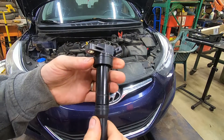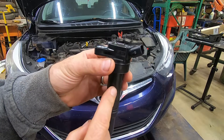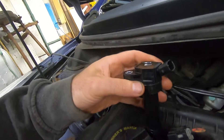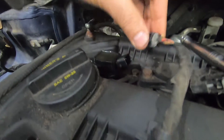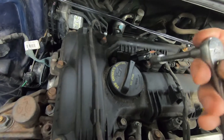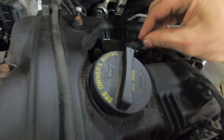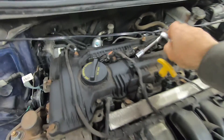Here's our brand new coil direct from Hyundai — this is a factory original. To my surprise, it was actually cheaper than the three aftermarket parts stores I went to, so yay Hyundai on that. Let's get the new one installed. Our spark plug is already down in the hole, so we're just going to drop the coil in place and put our 10-millimeter bolt back in there. Super easy to change. That bolt needs to be snug but not overly tight. Now put the coil connector back in place and put the little tab down to keep it from coming off.